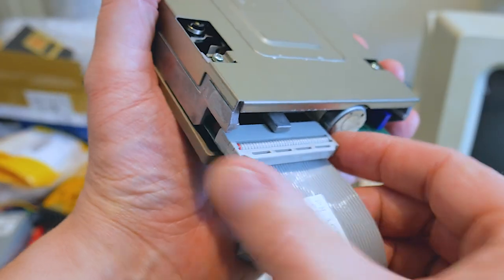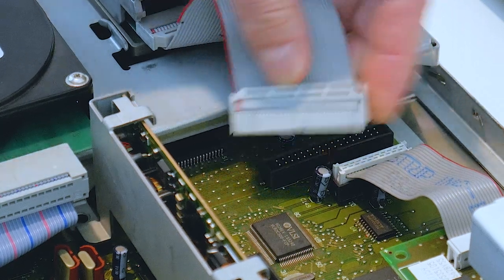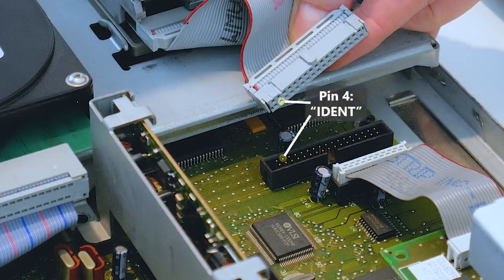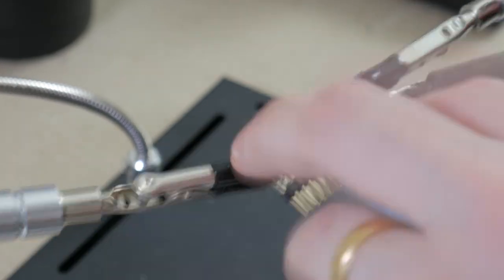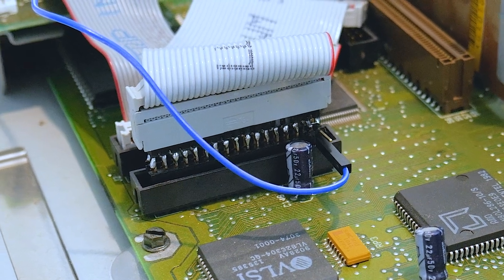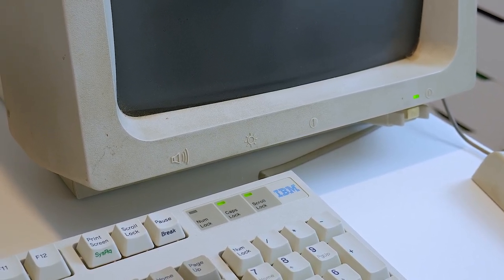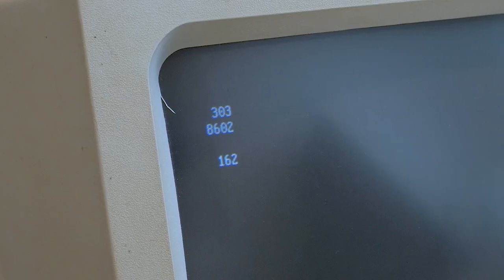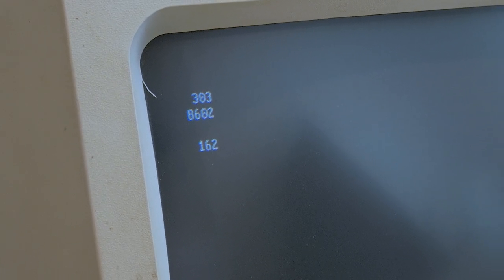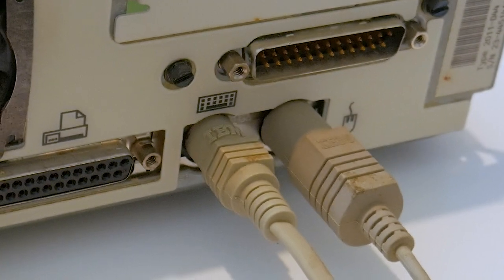PS1 and certain PS2 floppy drives are unique in that they have a drive identity signal on pin 4, while standard floppy drives leave pin 4 unconnected. From the system unit's perspective, if this pin is pulled to ground, the drive should be 3.5-inch and 1.44MB. Suspecting a fault with pin 4 on my drive, I soldered up a simple pass-through adapter that singles out pin 4 on the motherboard side and connects it directly to ground, but this didn't seem to make much difference. I only later discovered the problem seemed to be caused by the keyboard of all things. There are bad capacitors in my keyboard that cause a glitch if the keyboard is plugged in when the PS1 is being turned on, leading to the keyboard malfunctioning and endless beeping at the POST screen. This also seems to be enough to upset the motherboard's logic that senses the drive type. I've found that if I leave the keyboard unplugged when powering on and then plug it in afterwards, the keyboard works normally and so does the floppy drive. Nevertheless, I'm going to keep pin 4 grounded just in case.